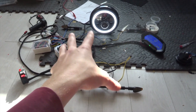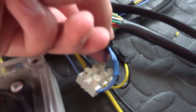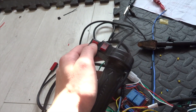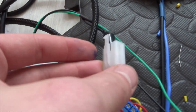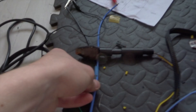It is finally done - everything is mocked up on the floor, so I'm going to give you a quick walkthrough of the new things. The dashboard here - I've wired up the main power, which is this blue line, to the battery positive, which turns the actual display on. Then we've got these buttons for the modes. Over at the handlebar by the throttle, we've got eco mode, normal mode, and sport mode, which will go to this wire here on the Sabvoton.